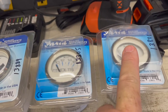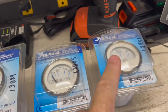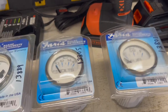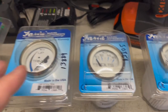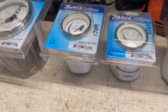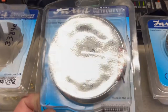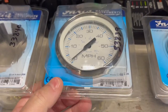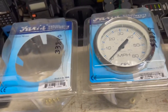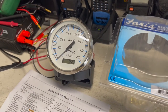The fuel gauge model number is 13801. I've already tested the fuel gauge on my fuel tanks and it works perfectly. Different senders do different things, so I wanted to make sure it works with my current fuel tank senders — and it does. The current gauge on the boat is already a Faria gauge, so it's a direct replacement. The voltmeter should be a fairly easy drop-in as well. I'm going to disconnect the pitot tube and cap it off so no water flows into the console.